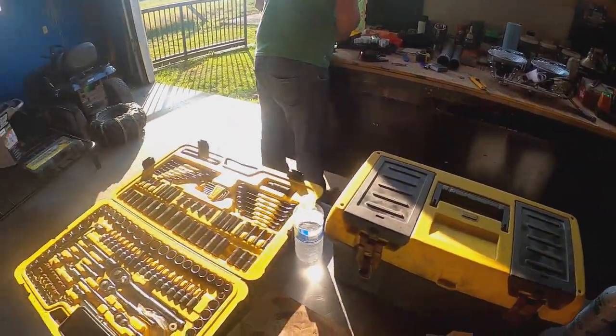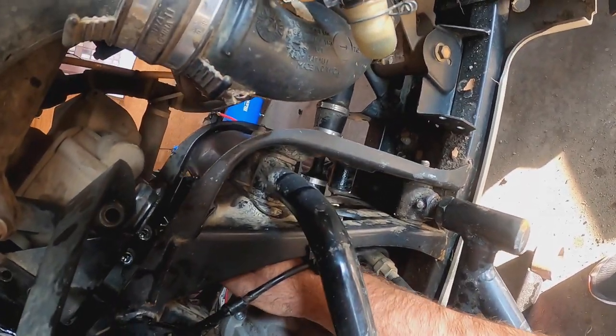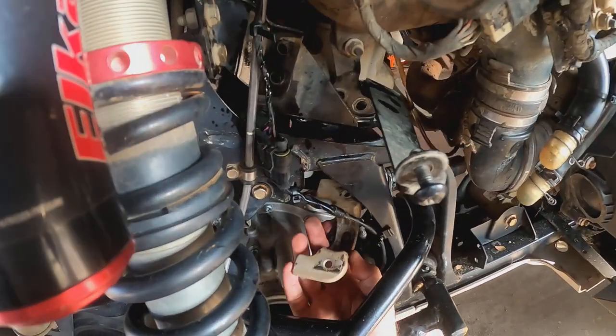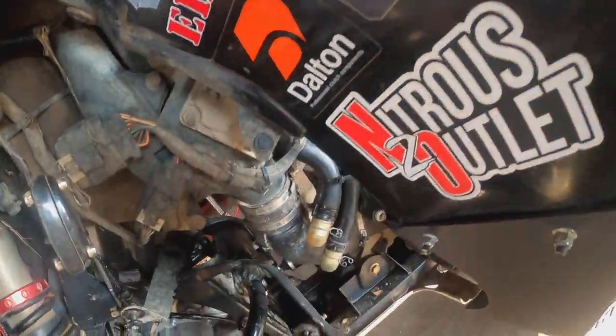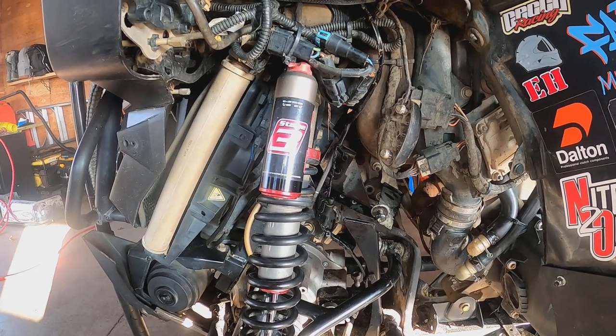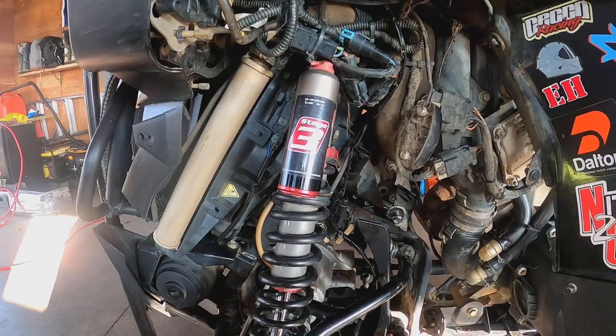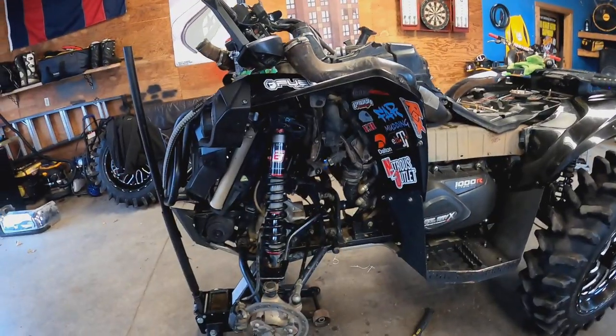Should probably feed the hardware back on. And that's where you need to sit. You should be able to bolt up the Pitman and still have movement to the power steering unit up and down if I need to. However, you shouldn't have to. I mean, that's coming up and out. So the only reason you should need to unbolt that is for the Pitman. I should be able to bolt the Pitman back down. I've got the Pitman arm in there.